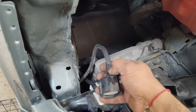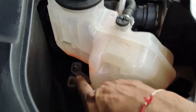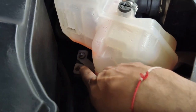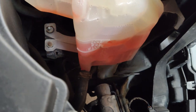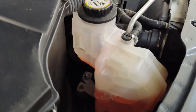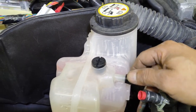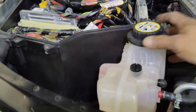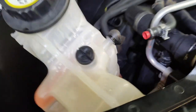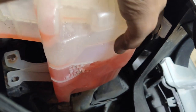With the headlight removed — remember there's only one connection; push it down and pull it from the headlight. We'll also remove the coolant bottle. There are two 10mm bolts on the back of the bottle and a button that catches it on the front side. Once you have those removed, you can pull it up and out of the way. I removed the return line and capped it off just in case we tilt it and it wants to spill. The other side is just a hook in a rubber grommet that releases when you pull up.